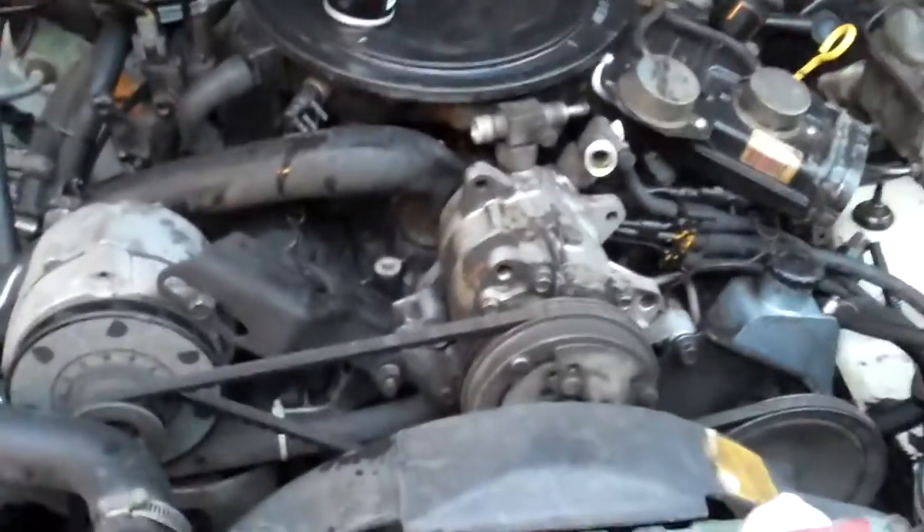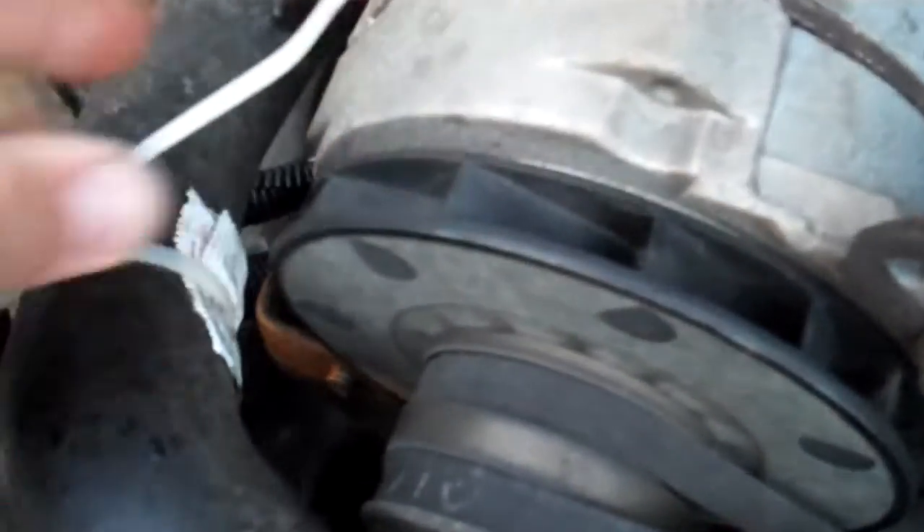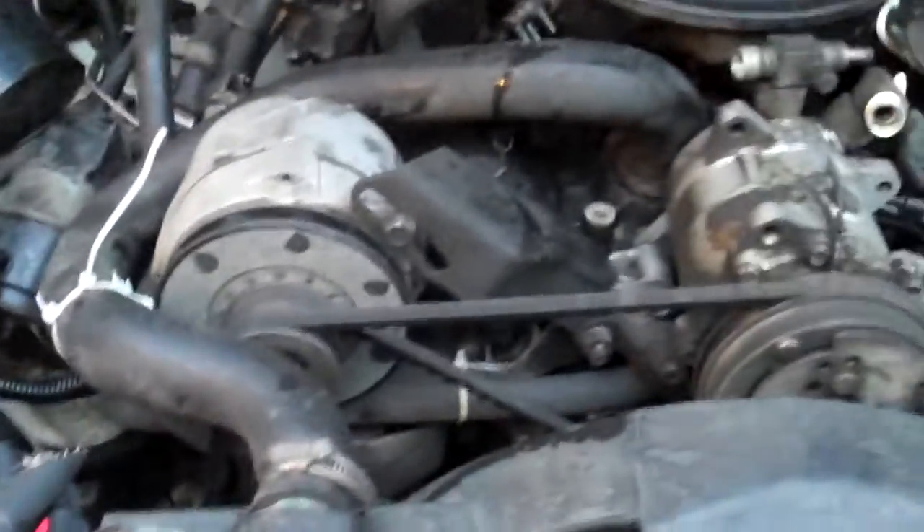As you can see here, we've got the amazing 2.8 V6 from 1986 that GM decided to bestow upon the world — one of the worst engines ever made, but it's all right. This hose came in contact with that fan on the radiator, or the radiator hose came in contact with the alternator fan. So it's a temporary fix — I squeezed some ketchup out of some packets, had some zip ties, and put those on there. It got me back here, but obviously that's not a patch job that's going to last very long.